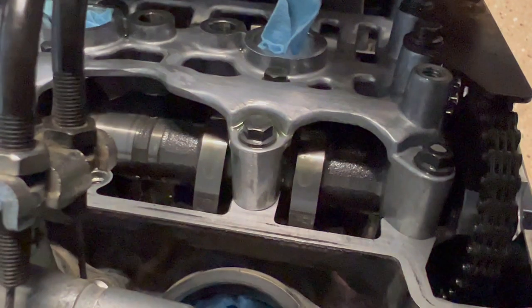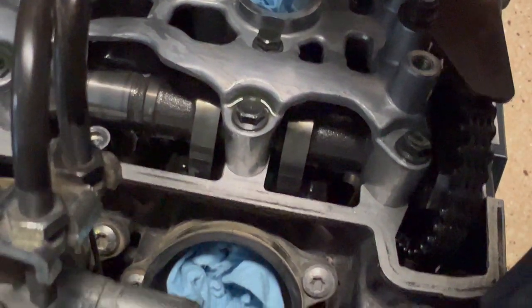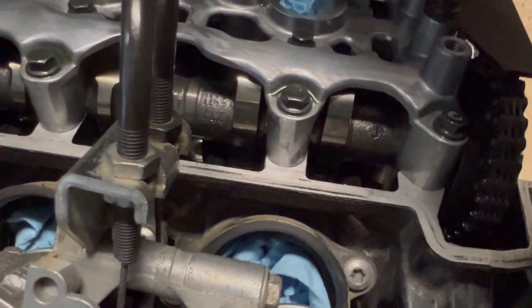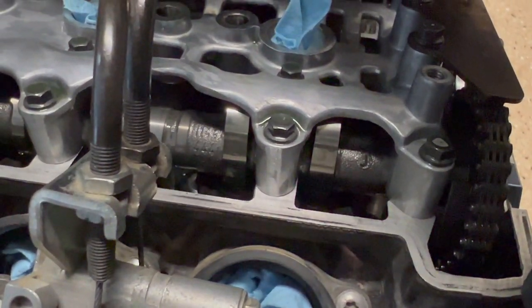So see these two cam lobes up here? They are currently pressed down on the buckets a little bit, so these valves are partially open, but as the crankshaft turns, they move up, eventually coming to the top there where the valves are closed. So then we can measure the clearances here between, again, the heel of the cam lobe, the non-eccentric side of it, and that valve bucket. And that's gonna allow us to get the measurements for our clearances.